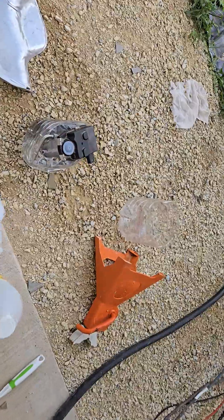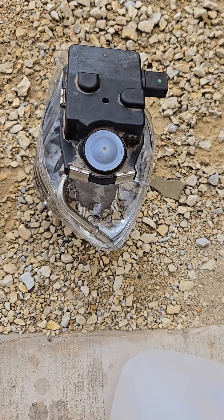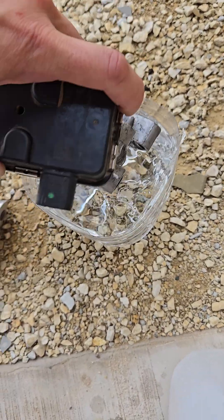This is just a funnel from Walmart. Here the EGR cooler is soaking in distilled water. Another point: letting it soak in purple power and cleaning both sides — you can see there's still some carbon breaking off from the water.